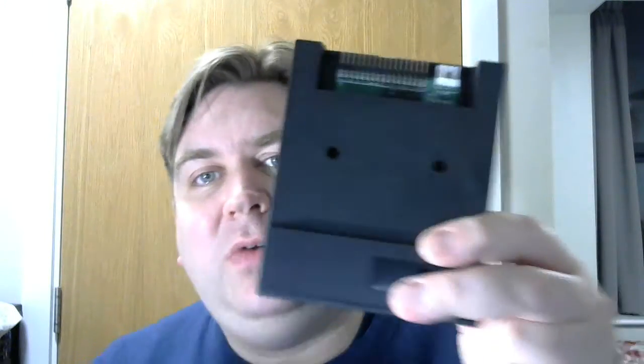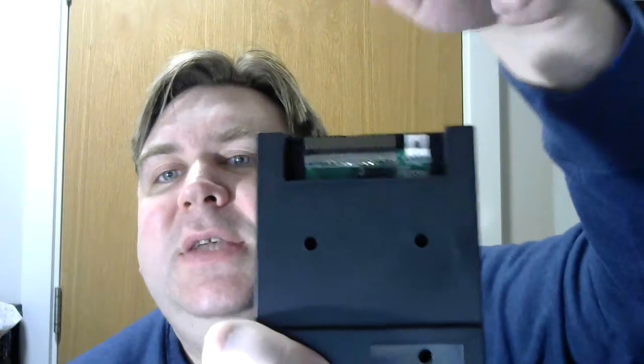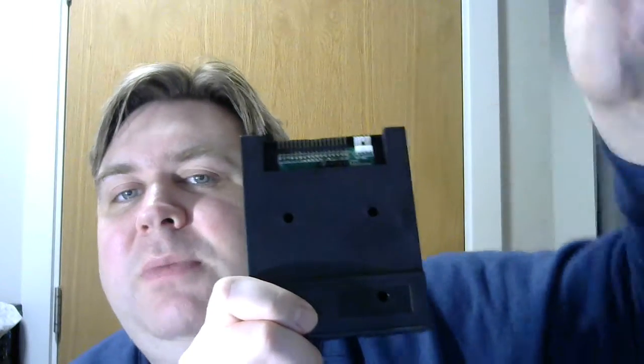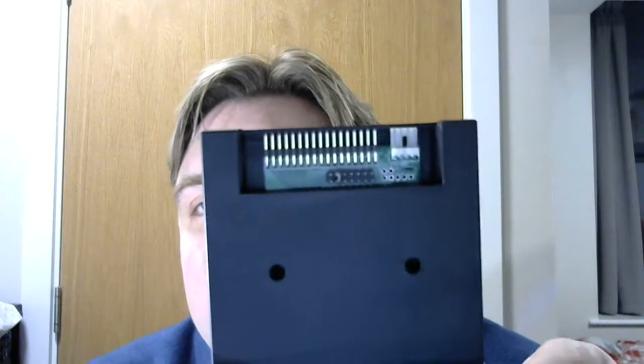I thought I was ordering a beige one and a black one came — that's the kind of thing you get buying from China; the description is a little strange, says it's for sewing machines. It seems these are always in black now. Another thing to note: there are jumpers on here. If you're using it connected to a PC that supports a 1.44 megabyte drive, leave it as is. If you need to change it for a 720K drive, you may need to adjust the jumper position. If you've got a normal high-density-capable BIOS, exactly as it comes from the factory is exactly what you need.